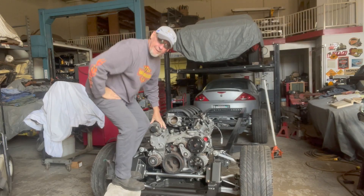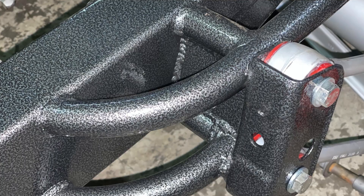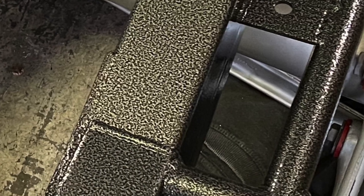As you can see from bouncing on the suspension, the transverse leaf spring is pretty stiff — it rides nice. You can have some issues up front if you're using a cast iron block; you'll need a heavier leaf spring. A lot of guys go coil-overs, but if you know the right spring it rides pretty good. With the early suspension that leaf spring isn't normally strong enough — you'll probably need about a 600-pounder. Over the years I've tried a lot of powder coating, but my favorite is Silverane Gray with a clear coat on top — you can wipe it over and it gives a nice artistic finish underneath the vehicle.